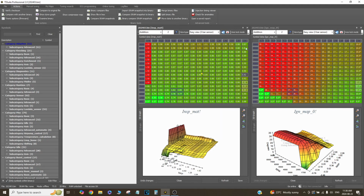So in the far right column, this is where the car runs when it's past second gear, when it's in third gear. Past 30 pounds of boost. So I actually run a 3 bar map sensor even though I overshoot it, just so it stays in this column and it makes the car run buttery smooth.